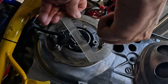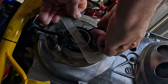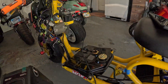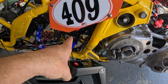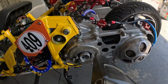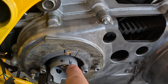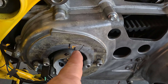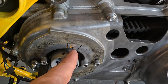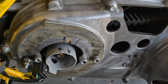28 is really somewhere in here — there's 30 right there, so this is really about 28 degrees. Now we're going to hook a timing light up to it. The timing light hooks onto the spark plug wire and goes to the battery to power it. Every time that wire fires, it shoots a light beam — and the light beam will only let you see this mark when it fires. We want this mark to line up on that 10-degree mark. We're just trying to get this thing close; we can fine-tune it later. I just don't want to blow the motor up right away. So let's start it up and time it.